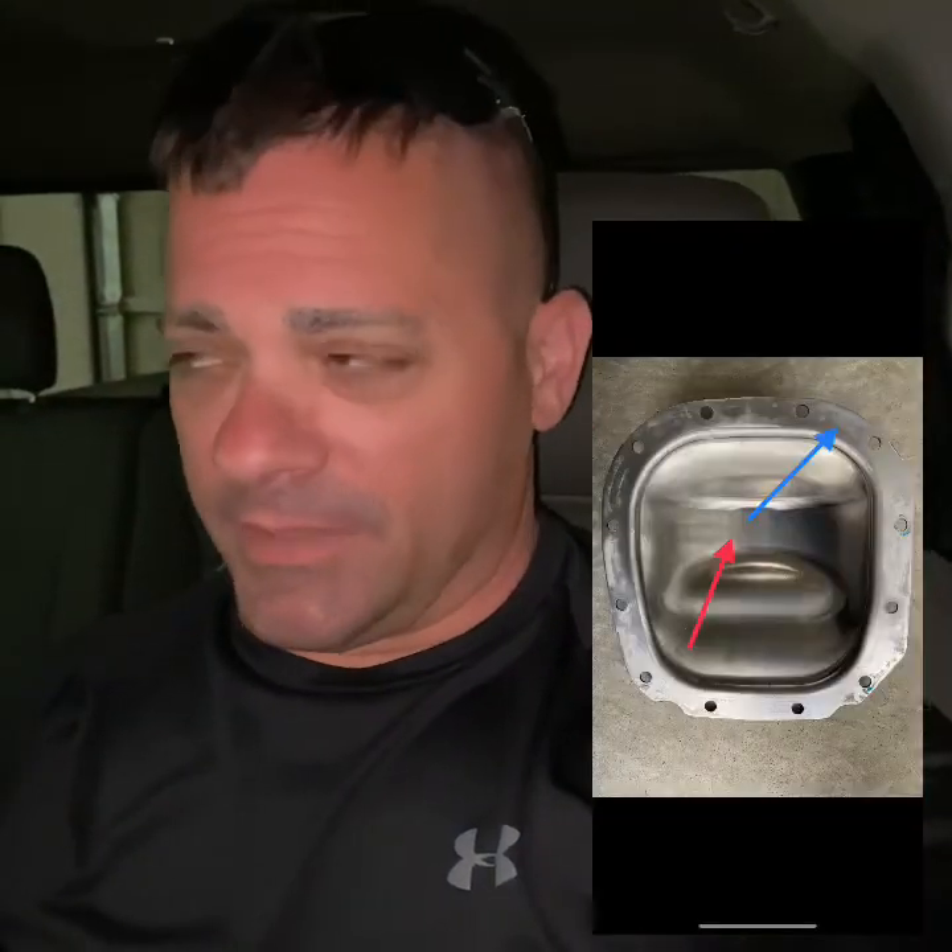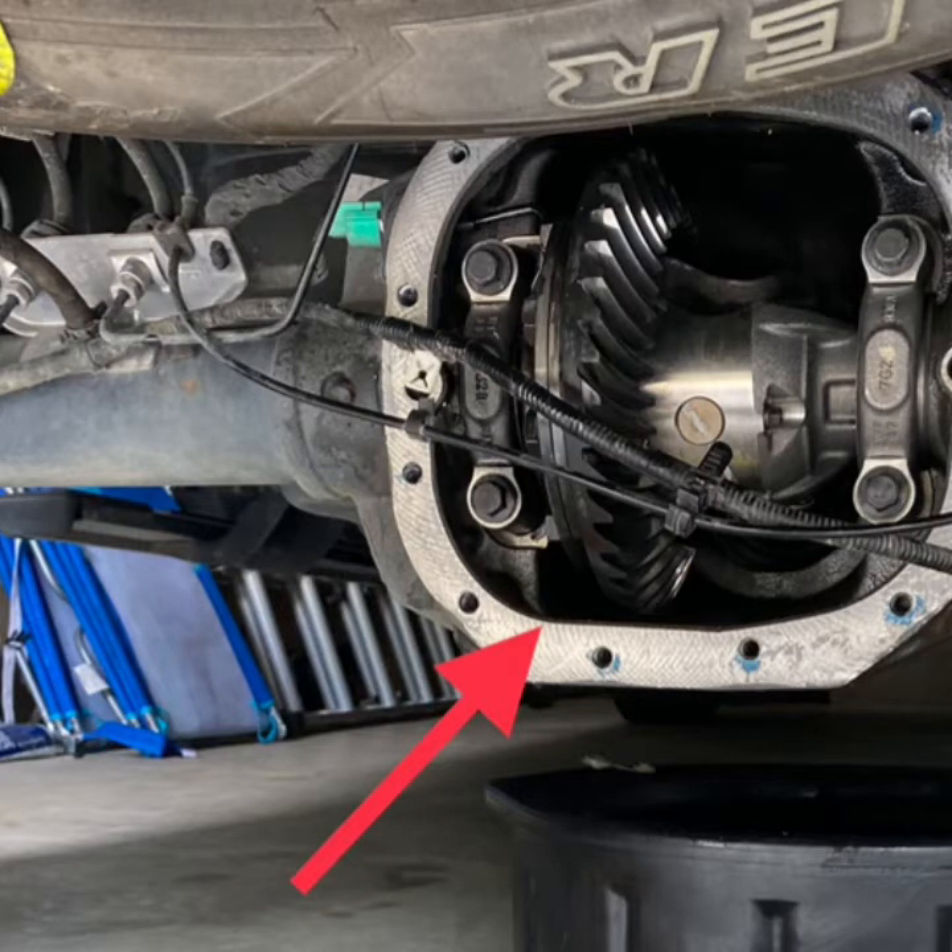You'll see the surfaces — the face plate should be shiny. I recommend sandpaper, then take a scraper and scrape off the old gasket material, clean it up with some Goof Off. I also recommend spraying some brake cleaner inside the differential to clean off the gears. You'd be surprised — they're not black and horrible; they're actually nice and shiny. Spray brake cleaner inside over the spider gears and in the bottom, then wipe from the sump — the bottom of the differential. Don't put anything else in there — no water, no gasoline.